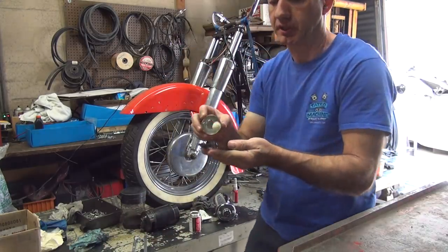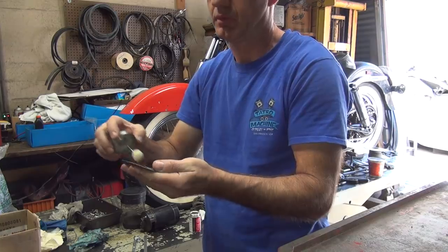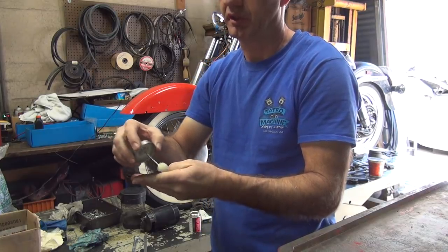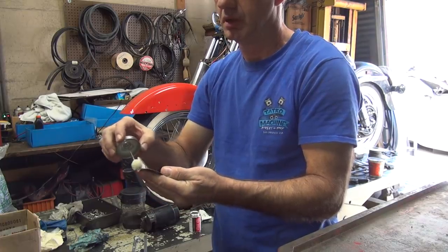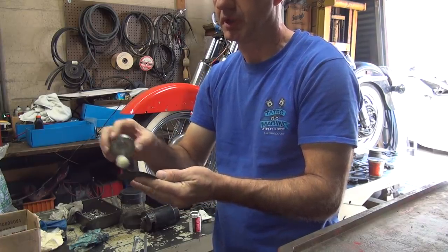Dip the one side of the gasket, you can take it back off. So. If you put a little bit of oil on the other side, it won't tear the gasket either. It's another trick you do. We're going to leave it dry. We're not tightening up that much.